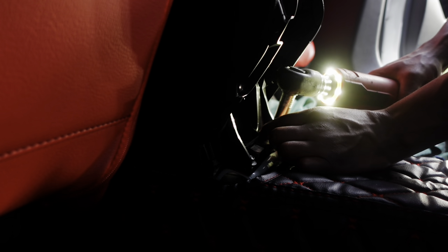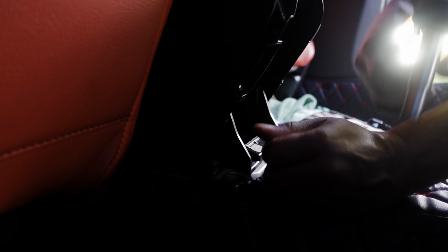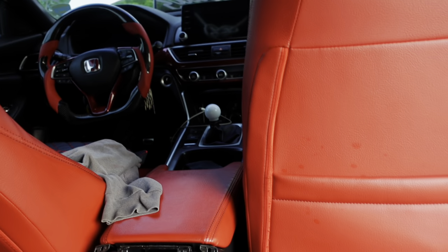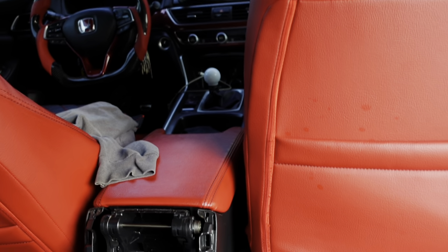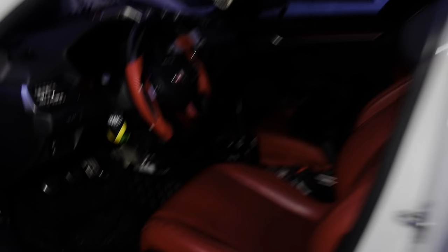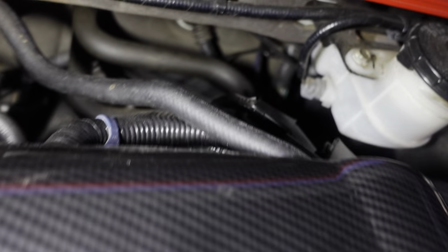Just unplug this connector - like this, like that. Throw these in the front seat. Unbolt these tens. Yeah. Unbolt the tens, put them in the doors so I won't lose them. So now you should be looking like this. The rest you do up front. I don't really need to show you guys how to take out all this - I have videos doing that. Let me just take out this center piece, I'm losing daylight. The driver's side airline is ran into the car. I run it through right there, then it comes out - ran it ran it through right there. You can see it.